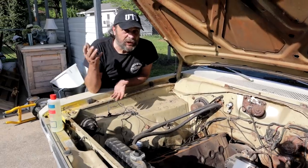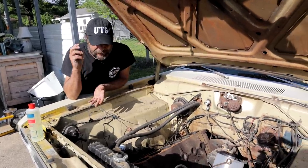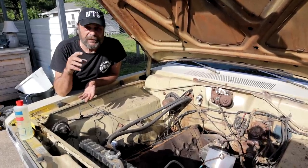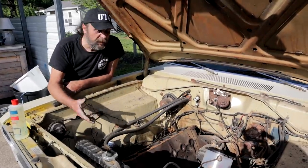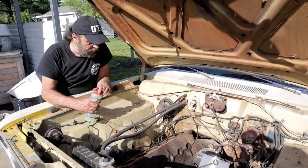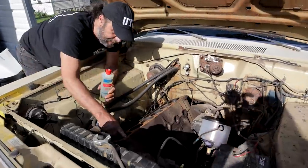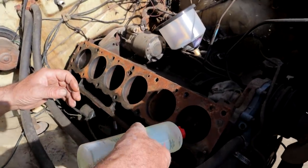This is an actual bonafide leak test where you'd use compressed air to see what the percentage of leak would be, or how well the cylinder seals. We obviously can't use compressed air here unless we put the whole motor together. So we're going to do the second best thing — use gasoline. I'm going to cover the head of each of the pistons and watch and see.